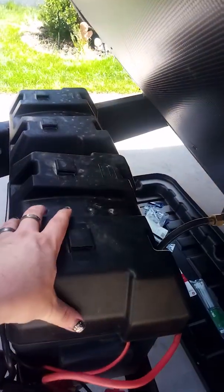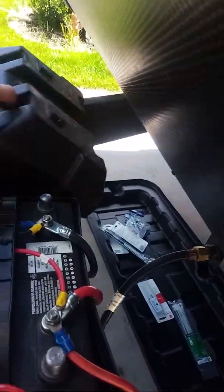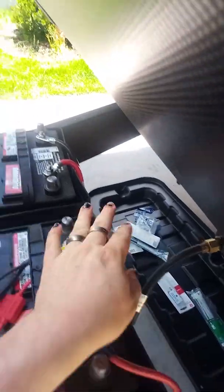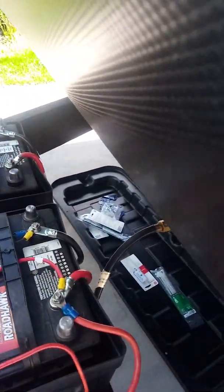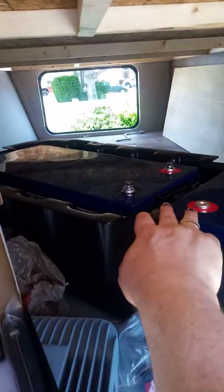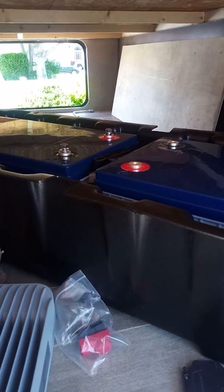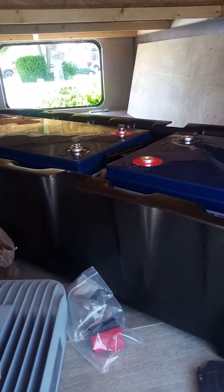I'm going to take here, so we're going to redo the batteries. I'm going to steal some of the cables off of these, use them on my battery bank, and then we're going to splice these in to some of that 8 gauge. Come up underneath through here, come out through this panel over this way, connect up here. We're going to push the batteries back in a little bit further once I've got everything wired, and then we'll start wiring in the charge controller.